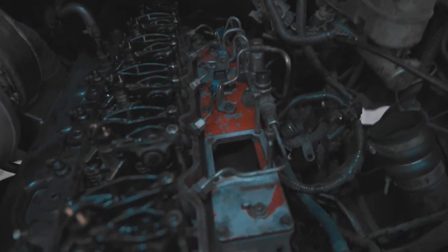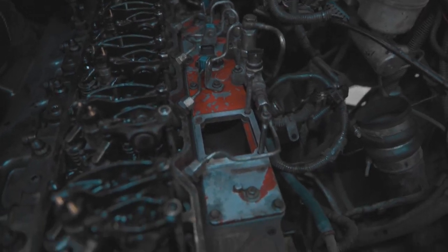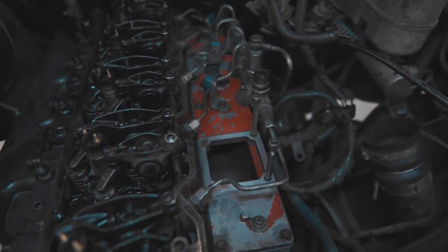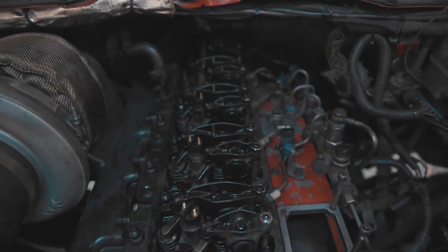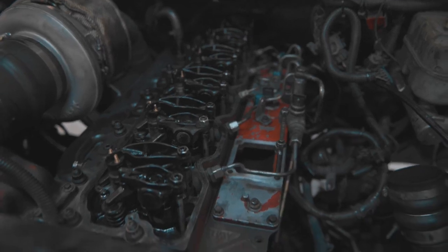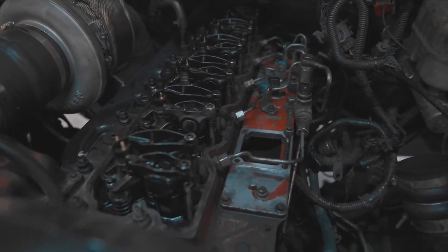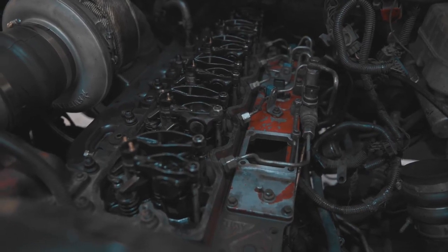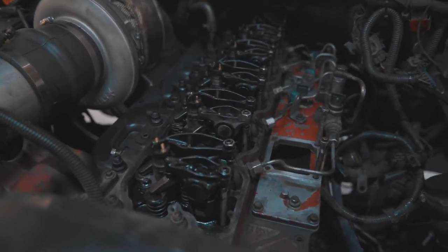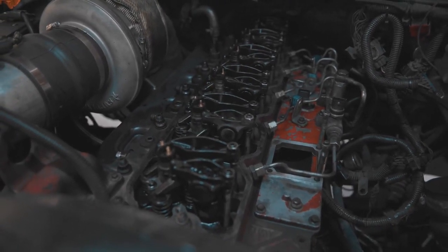So, I didn't time lapse it, but we got our fuel rail back in. We have our intake cover on, and we have all of the valve lash done. So, we're gonna start putting this whole top end back together and start the truck up before we start with our dual CP3 setup, which will probably be in a different episode. But anyway, throw you on the time lapse, and let's see if we can't get this valve train covered up.